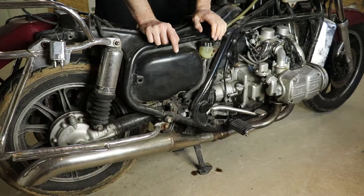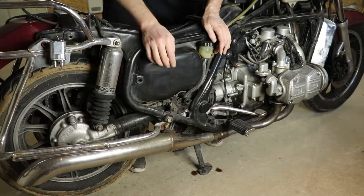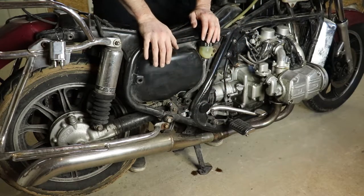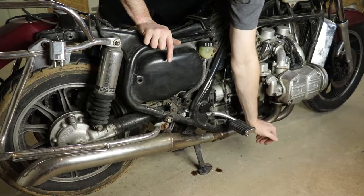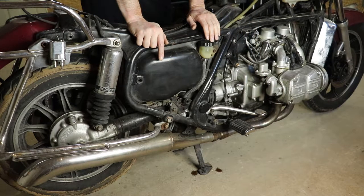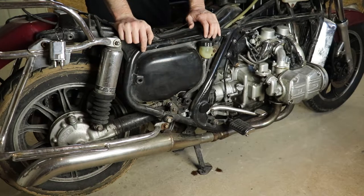So my plan is we're going to take the master cylinder off the bike. We're going to unbolt this here, take it down, take the brake line off, and unbolt the master cylinder — I want to potentially take that apart and double check to make sure all the seals are good and that it's not the piston causing this stickiness. Once we get that rebuilt, if things are all good then we should be good for back brakes. If not, we'll turn our attention down to the left side of the bike where the actual brake calipers are on the rear wheel. So without further ado, let's go ahead and get this master cylinder off.